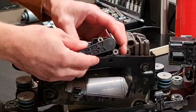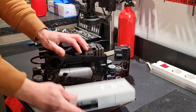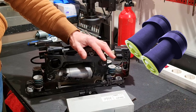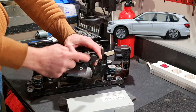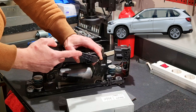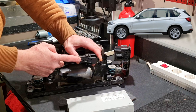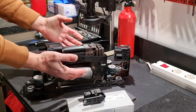This system is composed of two level sensors, one for each wheel, the rear wheels, the control unit, the air compressor, and two air springs for left and right rear wheels. When the car is loaded, the sensors will see this difference. The control unit will turn on the air compressor to charge the air springs and the car will return to its normal level. When the car is unloaded, the car will be higher; the control unit will command the solenoid valves and the discharge valve to open, releasing the air from the air springs to return the car to its normal level.